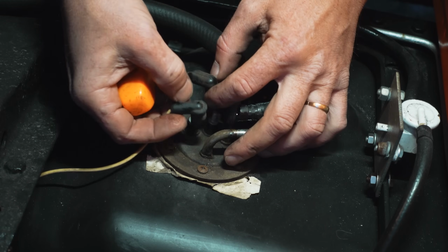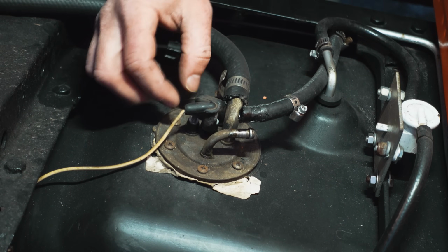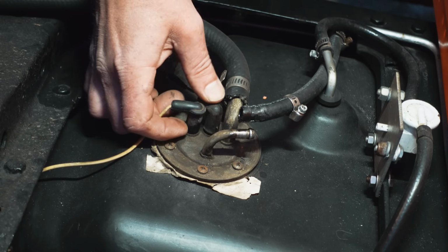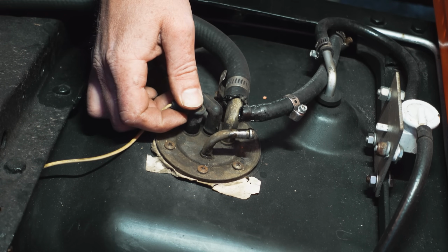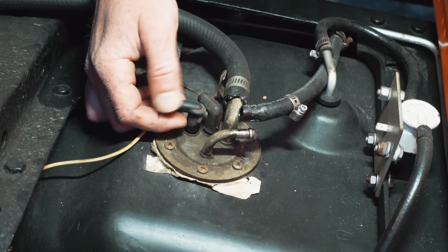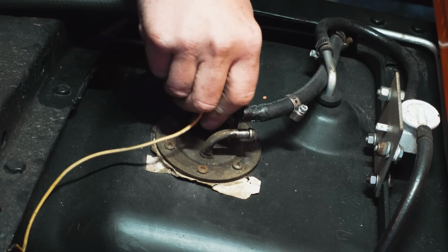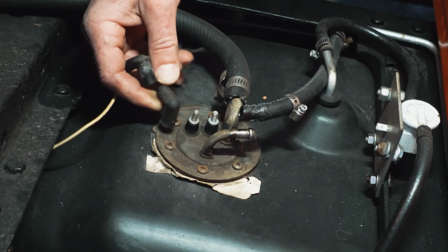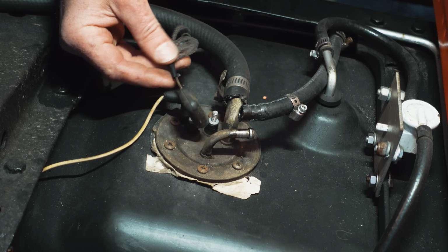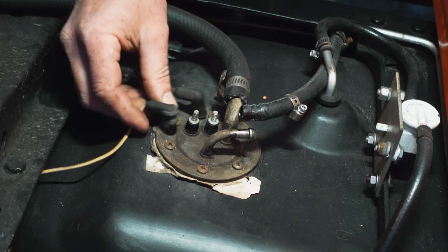As far as the float goes, what I didn't consider is, like, did he have them backwards? You know, the sending unit wire and the ground, and then full would be empty, empty would be full. But I did put gas in it, so it's not empty or full, and we should have some reading if they were backwards. That's kind of my logic on that, so I'm not going to sweat that right now, but that is something to consider on a build. I have to remember that the signal wire for the sending unit was closest to the vent tube.